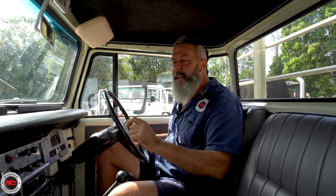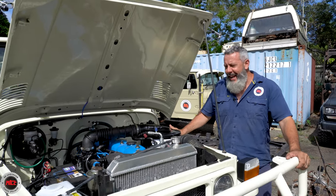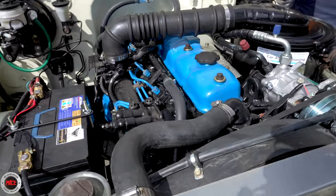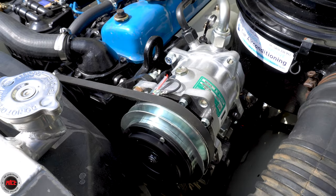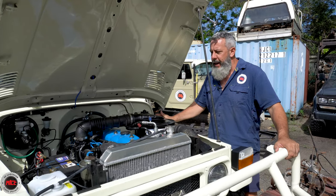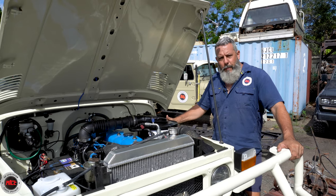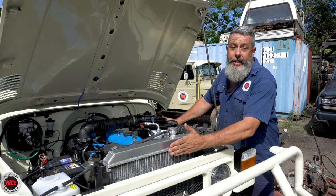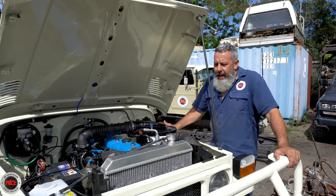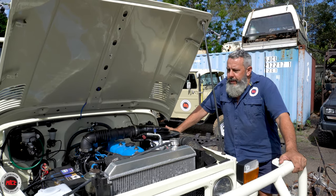Let's go under the bonnet because it's shiny under there, and this car's got a few extras that didn't come with it from Lloyds auction. I should have my sunglasses on — it's so shiny, and the paint job in here is so nice. Didn't miss anything: pulled the engine down, painted everything, all new components. Here's your aircon compressor, so the air's inside. It doesn't only have air — over here we've got the 40 factory power steer, so that's been added. And one more little bonus that 1980 didn't get is the disc brake upgrade from the later 47, so Gus has gone and put all that in. Alloy radiator. He doesn't have the condenser up the front — he's actually mounted that with a couple of thermo fans up under the tray, and it's well tucked away in there.